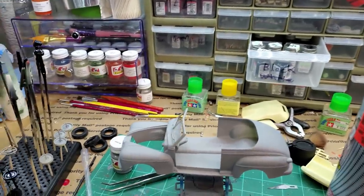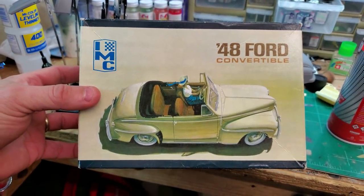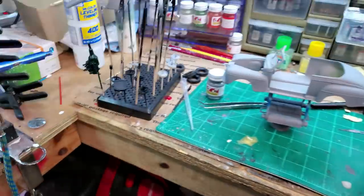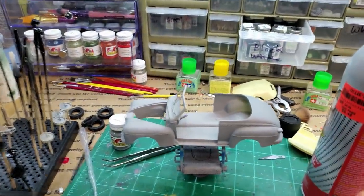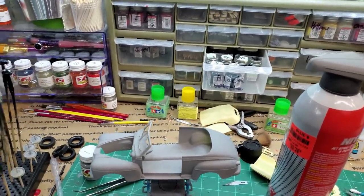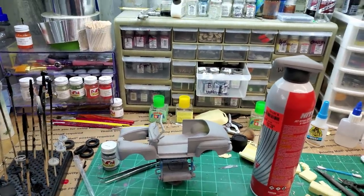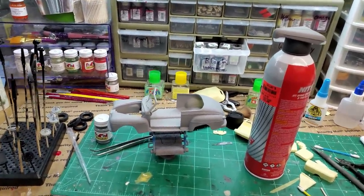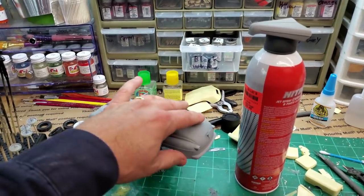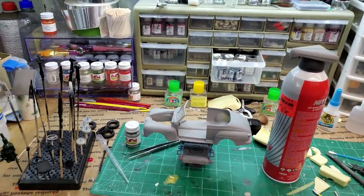Something like that. I think it was a Karate Kid car — I think it was a '48. Anyway, it was about this color. I want to go with some sort of cream color — I think that would look really good on it. I don't have a cream color, but I have some Wimbledon White and I think I'll mix it and see what kind of color I can get out of my MCW paint. I'm going to do a light sanding first on the body with about 1500 or 2000 grit just to knock some of the rougher places, since my air pressure was a little high and the back is a little rough.